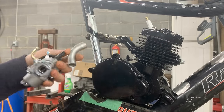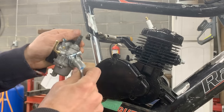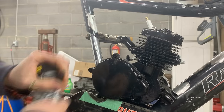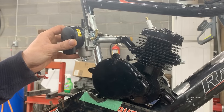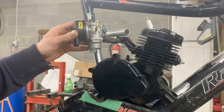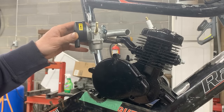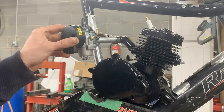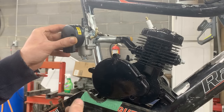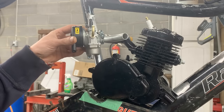So I found this aluminum tube, which is the exact size of this, fits in perfectly, and it is the exact same as this as well. If we connect it here with a piece of hose, that would be a perfect solution. It is a little bit too long, so I'm thinking if we cut it somewhere there and we put the hose between these two, that would be great. And it's gonna reduce the angles too, because the more angles you have here, the more restricted the airflow is gonna be. So I'm just gonna cut it here on 45. I'm actually happy about it.